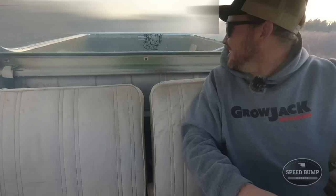That was a pretty good one. Well that was awesome. I would say the Ranchero Revival is well underway. It runs surprisingly well. I think we're a little low on transmission fluid because I was getting a little bit of slippage in between gears, and we have a little puddle under the lift where it was parked. Definitely need to get some transmission fluid in it. My eyes are burning - it's a little smoky in here. The heater core is leaking coolant - that needs bypassed and replaced eventually. There is still a ton to do on this car but that right there was cool. Made the disc brake conversion worth it. We've done nothing but brakes and suspension - still have so much to do on it. We appreciate you guys watching, see you on the next one.